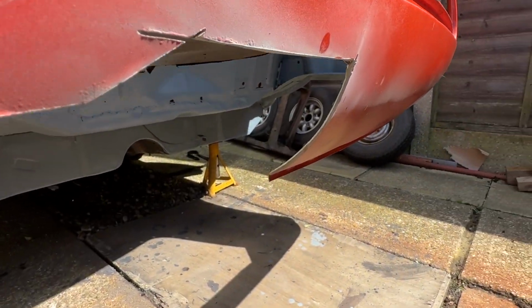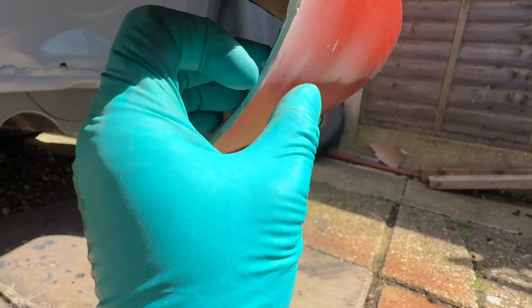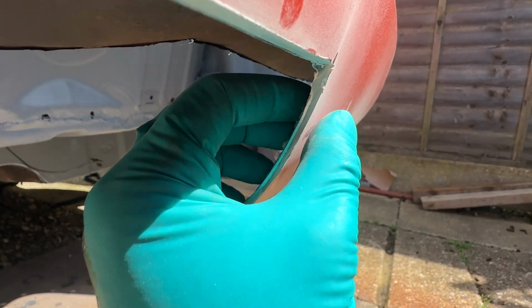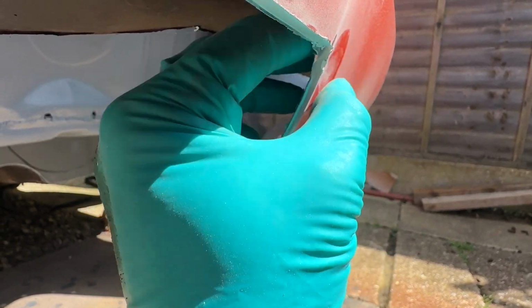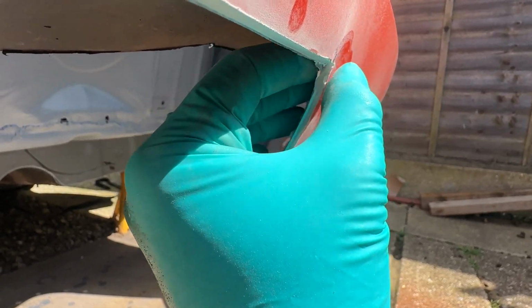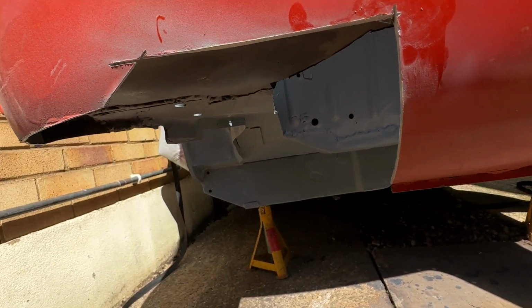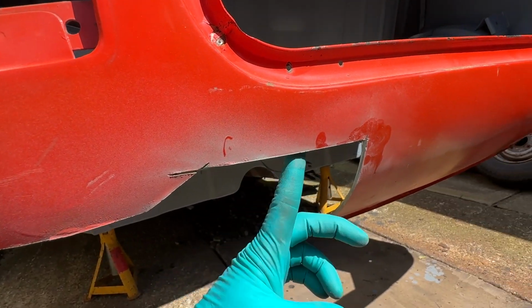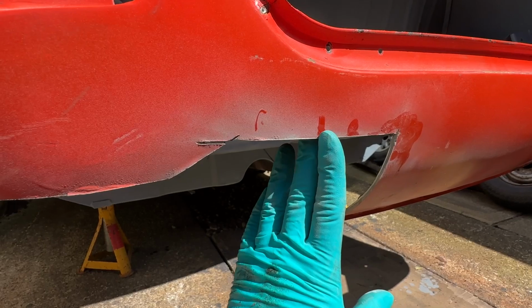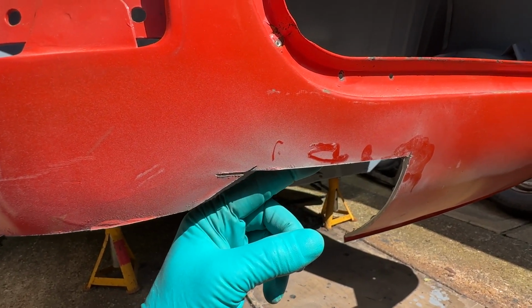Okay, have a look in here. I've just taken this corner off, as you've seen. I thought I'd show you how much filler was actually in this smooth boot lid. It gets worse as it goes up. It's probably close to peak thickness there, but that's a hell of a lot. My reason for cutting the corner off is, you see there's the tip of my finger. The top is kind of here, and I want to work up to it gradually.